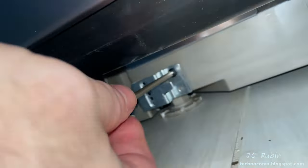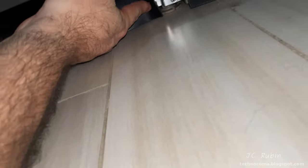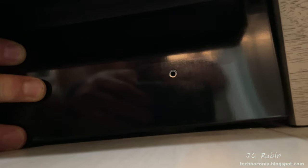I move on to the final brackets that lock into position, with a screw hole up top. The screws are added after the brackets are installed. The black rubber flap is dropped down and pushed behind these tabs, followed by the installation of the bottom cover. Getting alignment between this hole and the bracket, moving it up or down as needed, the screw is installed through both sides — completing the installation.